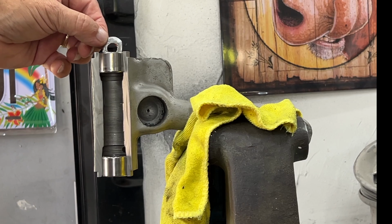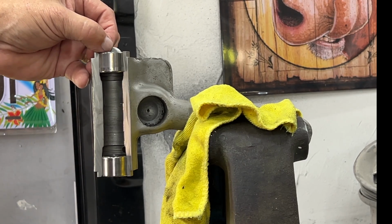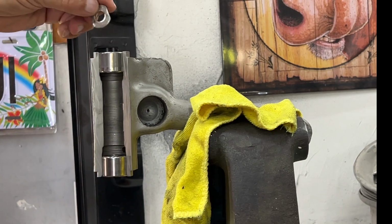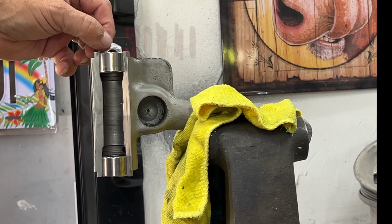Merely orientate the washer or the tool so that it drops down through the upper bearing. You may want to use your finger to stop the washer so that it catches the lip of the lower bearing and does not fall all the way through.